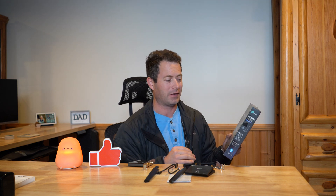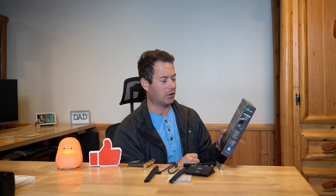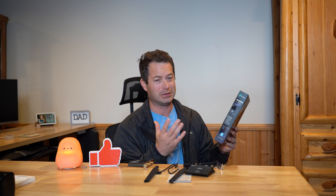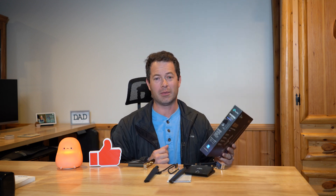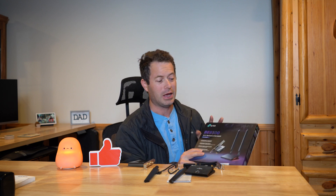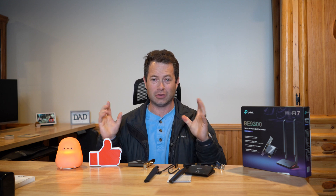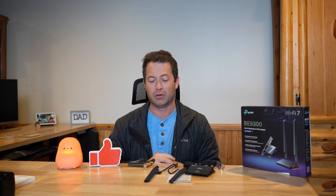The max theoretical speed goes from 433 Mbps today up to 5,760 megabits per second on the 6 GHz band with Wi-Fi 7. Even on just the standard 5 GHz band it's 2,880 megabits per second — theoretically faster than the 2.5 gig ethernet in my house. I'm also only about 15 feet from one of my Wi-Fi access points, so I'm hoping for good signal. The key use case is local file transfers to my NAS, not just ISP speed.